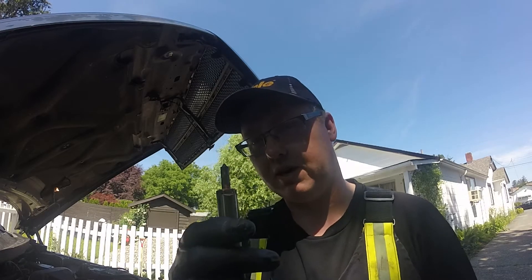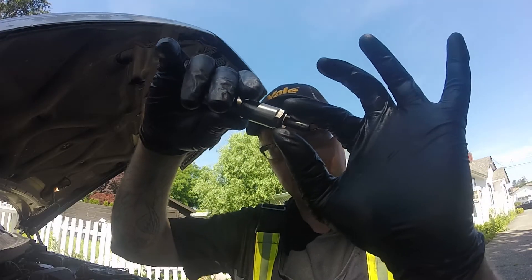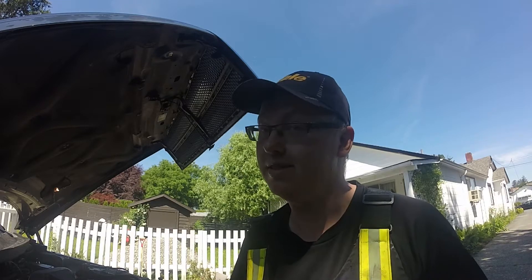When we go to put this back in, one thing to make sure of is this can come off. If you're having a little trouble once you get it into the hole, don't try to jam it — you could damage the gasket and then you'll have to use a thicker one on that cylinder, so one is going to be a little less power.